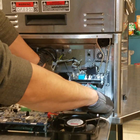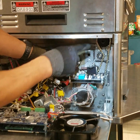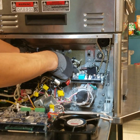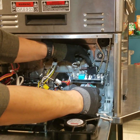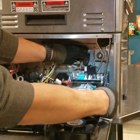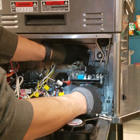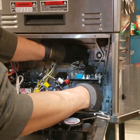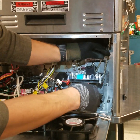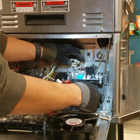With the 4 hex nuts pre-installed but not tightened, reconfirm once again that the drive chain is correctly routed and engaged with all the sprocket teeth. Then compress the spring tensioner to the left and slide the motor bracket to the left, which will tighten the tension. Keep doing this until the motor chain deflection is approximately 1/8 of an inch.